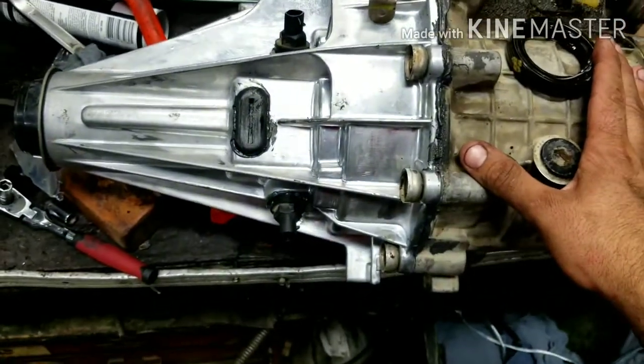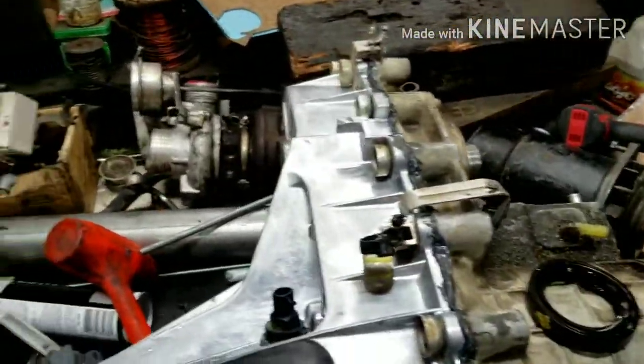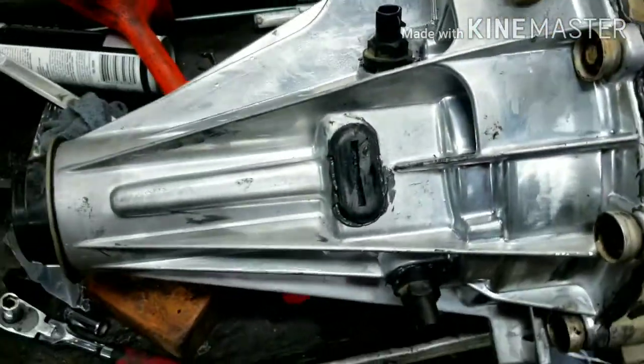The primary cause is that there's a hydraulic pump inside the transfer case that goes back and forth repeatedly, and it creates a hole. I'll show you — this is the new one. You can get a brand new piece from Dorman; the part number is on the box right here.